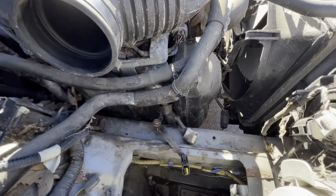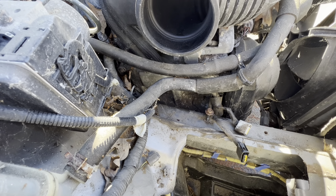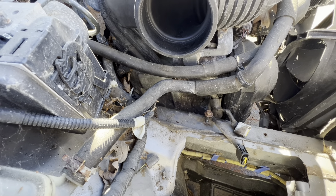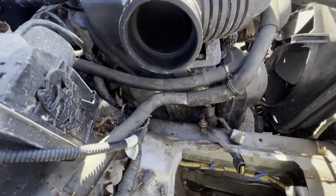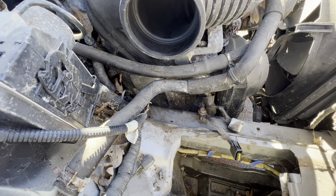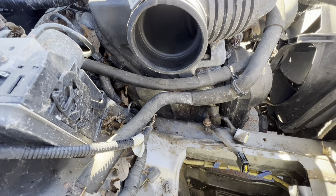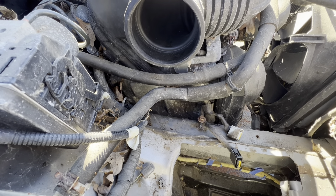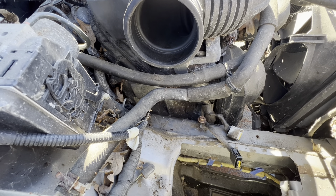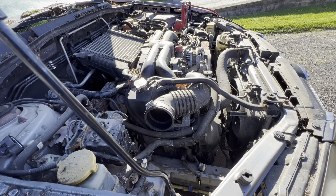I removed the air box and both coil packs and spark plugs on this side are actually missing. We're going to hook the compression test up later and see if it's even worth going to get two spark plugs and coil packs. I did look at the driver's side and it was fine, but this side — I don't know if they needed them for something and this was just easier to get to, or if this motor had a compression issue before it was parked and they just slapped everything back together. There was no air filter and the box wasn't all the way seated down.